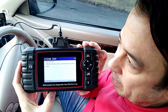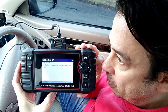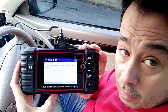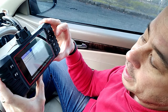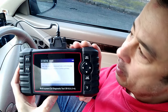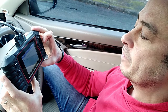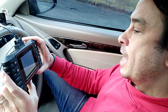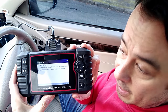What's interesting about this is I doubt very much that all the sensors have gone wrong at one time. What's more likely is that whoever had the vehicle before me disconnected it, turned the key on, and the bumper and the control unit for the Parktronic weren't actually connected, and it's thrown a fault. Historically it's sitting on the car, but we can clear it using this iCarSoft. The next one is: no CAN data was received from control module, electronic ignition switch, or central gateway. The CAN bus is telling me the vehicle hasn't been able to carry out communication between control units for the parking. Faulty CAN communication to the instrument cluster as well, and another driver signal acquisition fault. So they're all related.